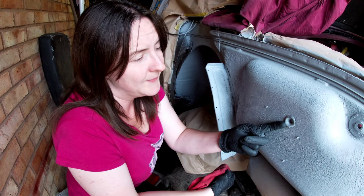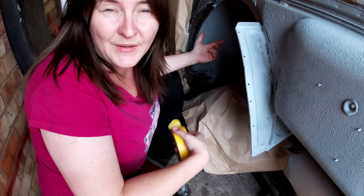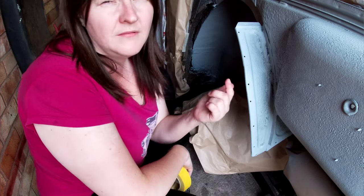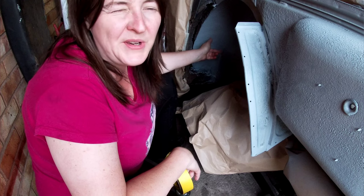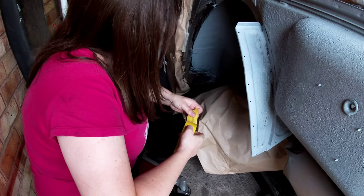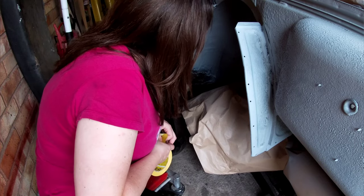I should have taken that rubber bung out, but it's absolutely solid. I ain't replacing it - it can just stay there and get painted. I'm pretty much ready to paint now, but I'm just going to mask off some bits, because there's obviously the D-post that will need welding. So I don't want to put fresh paint near to where we're going to be cutting and welding - because one, it's a waste. Two, it's a bit dangerous because the new paint can sort of melt and catch fire. And three, it just makes it a little bit awkward because if I've painted all that and then we've got to cut it, you're cutting through the paint and it's messy, and you're trying to weld and it's going to splatter. So I'm going to use some masking tape to keep a clean area around where we're going to be cutting and welding in the future on this D-post. It's going to look a bit pants but it will make sense in the end.